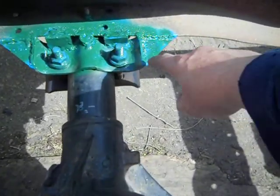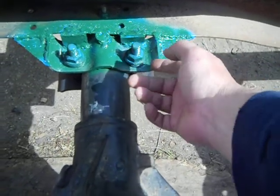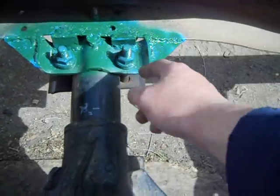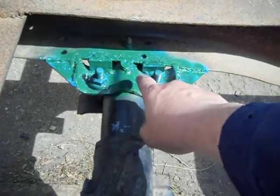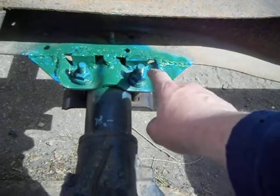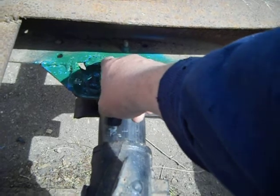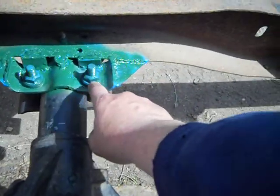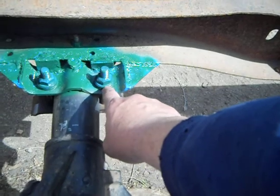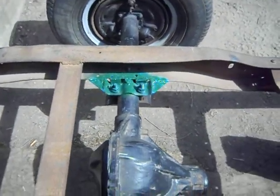I'll get down here and show you this. These were the pieces that go on top of your leaf springs, with the U-bolts coming up from the rear end. These bolts held the eye-bolt to the shackles. On the end of your leaf spring you've got your eye-bolt, which I recycled. Cut these in half — a couple little blocks of metal there to take up the slack — gussets. The bolts had the washer up, and the washers came from the U-bolts, nice and thick. Recycling everything that came off it.